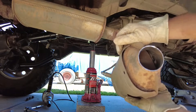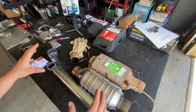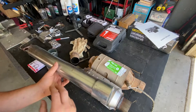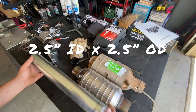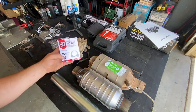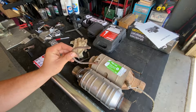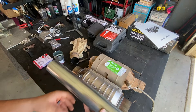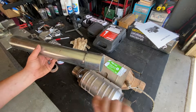Oh yeah, that's bad. Okay, here's my plan to organize everything and get it put back together with the new parts. I went to my local AutoZone and picked up some exhaust tubing — this is two and a half inch inside diameter — and I picked up another adapter and a clamp as well, because I actually busted the clamp on the muffler side downstream of the cat.